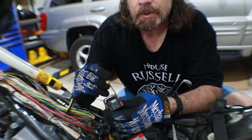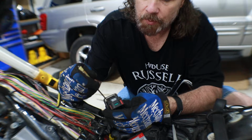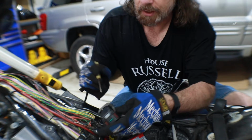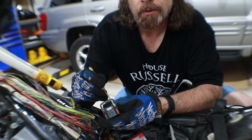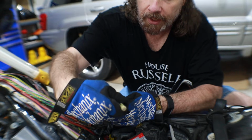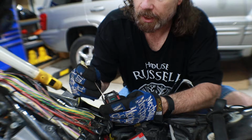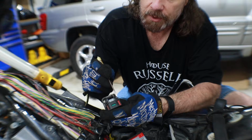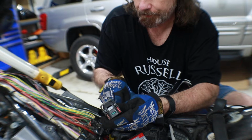There's two pins here. This is where it's the first place it's being held in, and there's two hooks at the back here that are also holding it in. So if you stick your little screwdriver above in this little hole and you pry upwards, prying might not be the right word, you're not trying really hard, but if you lever it up, leverage that up against the bottom piece, it pulls those tabs out.